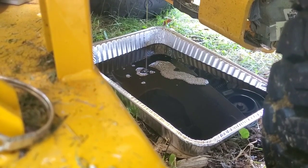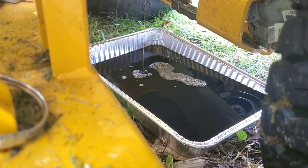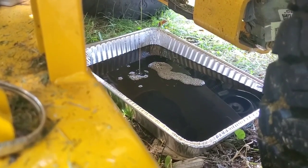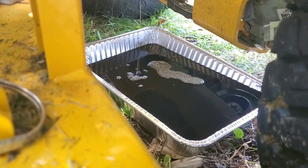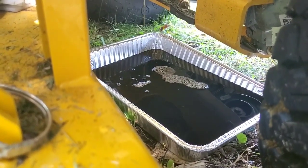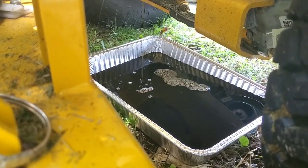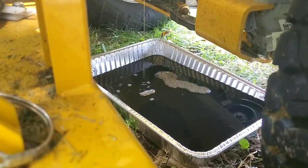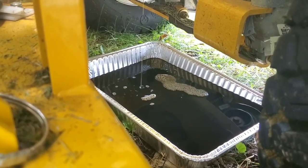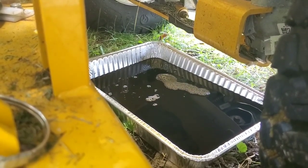That's when you first get a mower, it's kind of breaking in. And, you know, there's a lot of shavings and stuff. I've talked to a lot of people and they say there's really no need for that. Now, if you watch my other videos, I was a big advocate of doing that oil change at the 5 to 8 hour point. But after talking to some mechanics, and specifically someone very big at the Wright Mower Corporation, says really there's no need for that. Yes, you might have shavings in there, but that's what the oil filter's for. So your oil filter's gonna catch it.